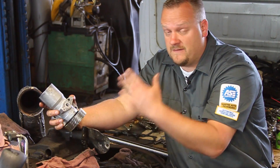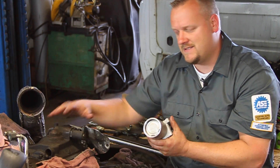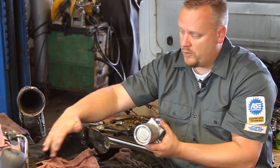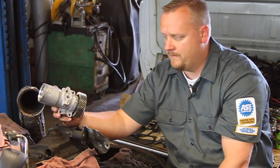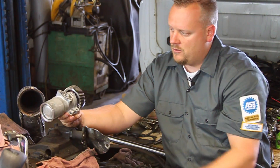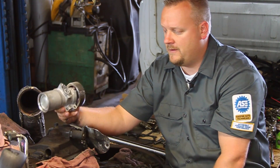Otherwise, if the cab was on, you'd be removing the turbo and probably removing the exhaust Y-pipe in order to access this particular housing which covers up the high-pressure pump. Now that we're down to it, we're going to remove a couple bolts here, get this housing off, and we'll find the pump submerged in oil. It's gear driven off the back of the engine, so we're going to go in there, suck the oil out, clean up surfaces, put some new O-rings in, and put this new pump in place.